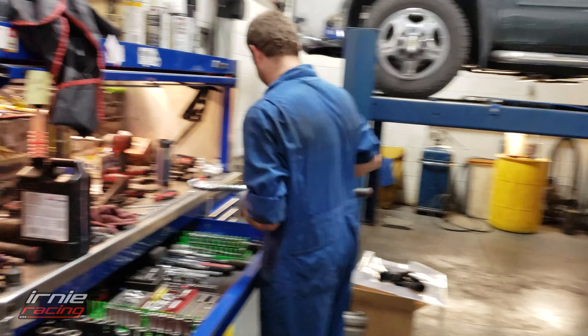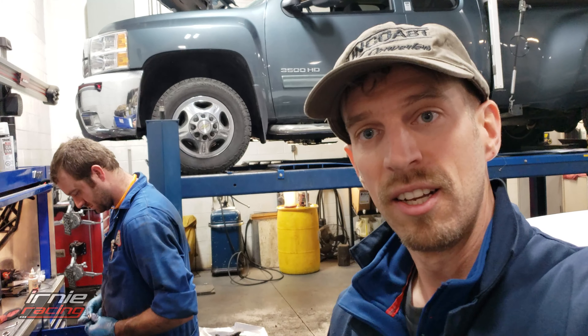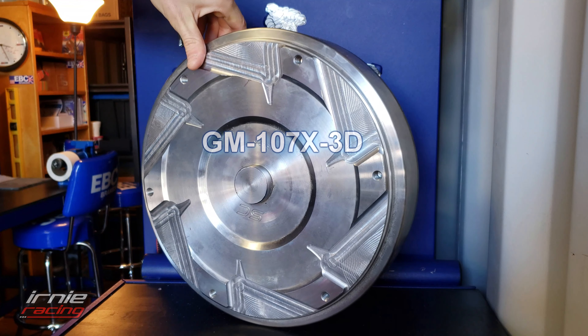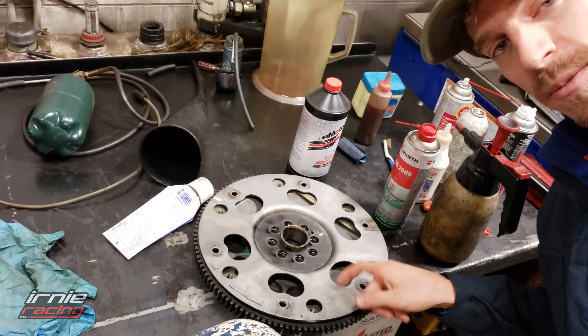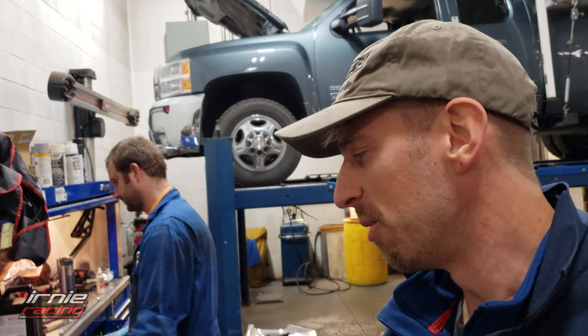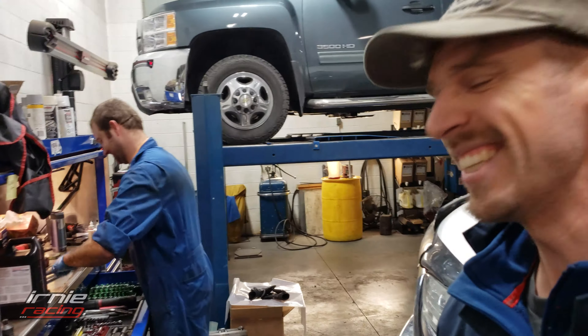Tools away — that's a wrap, guys. My name is Marcel Ernie, this is Andrew Gull, we're at Williams Automotive Kelowna. The Duramax is done — transfer case, driveshaft, everything is back together. We installed a new Suncoast Diesel billet flex plate for the LMM, along with the Suncoast Diesel 1800 RPM low-stall triple-disc billet torque converter. Unfortunately the stock flex plate didn't show any visible cracks, so if the knock stops it'll be a random blessing — maybe it was the OEM torque converter. Let's hope it's just magic.